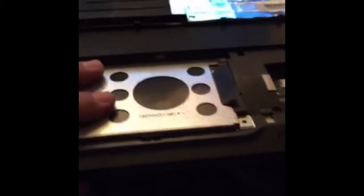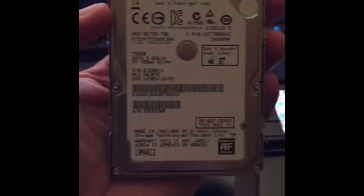So to remove the drive, it's very easy to take it out of the laptop. You just pull back and then lift it up. Be very gentle with these — you don't want to drop them. That's a traditional 750 gigabyte SATA 3 drive. It's nice because I got all that space, but I wanted to have it faster. This is how easy it is. Now it comes with a little plastic piece that'll help it slide in, but it's super easy. You just turn it upside down, take it and pop that sucker in. Of course put all the screws in, put the back panel on, put your operating system in there and install your drive just as you would anything else. And yeah, you should be good to go.